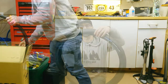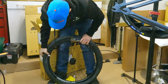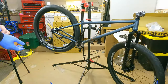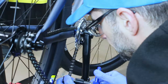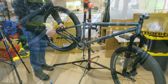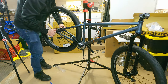In the meantime, I unpackaged the tires and let them sit overnight to get their shape. I'm using Michelin Pilot Pump tires — chunky 26 by 2.3 slick tires that work really well on pump tracks and smooth dirt jumps. We're using a half-link chain by Odyssey BMX. Half links are a little heavier than a standard chain but help fine-tune chain length. On this bike the dropouts are really short, so I couldn't use chain tensioners — I tried two different kinds and neither would fit.